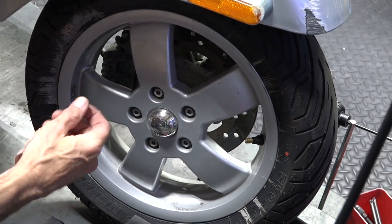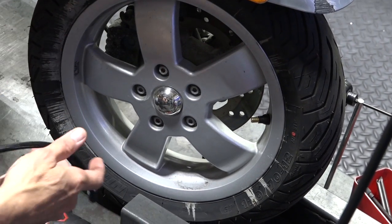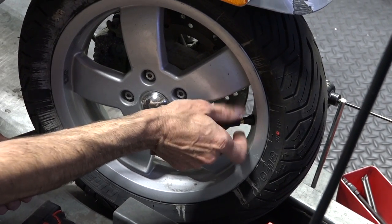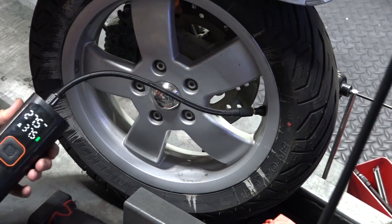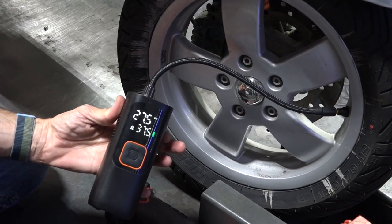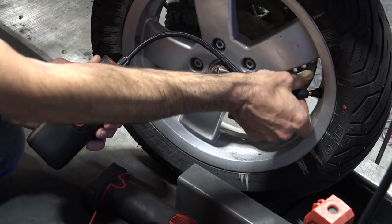I never really clean the scooter so there's some goop on the side of the tire. Also give the tire a spin — look for any nails, debris, or cuts in the tread. That's always pretty important to do; a lot of people overlook that. Checking the pressure and knowing what it is gives you an idea of how things are. Pressure is pretty good — I'm happy with 27.5 psi in there.